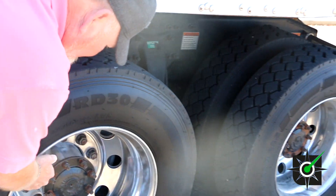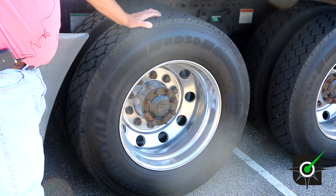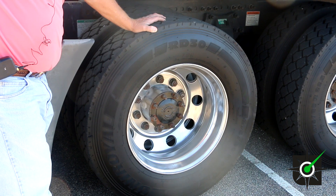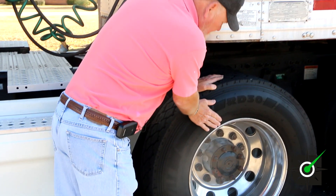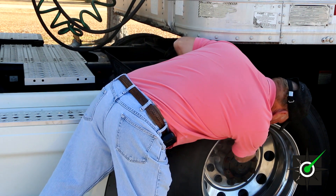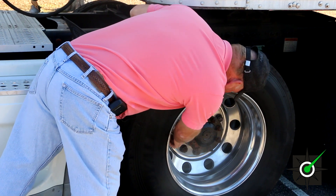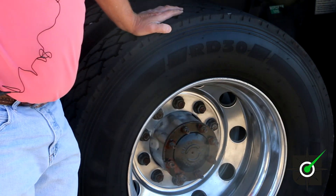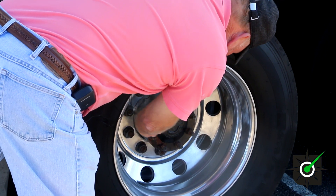Back out to the wheel — the wheel cannot be cracked, and no illegal welds. You can tell them that tire's pumped to 100 pounds of pressure, and you check it with a valve stem. The valve stem is on there, bolted on tight, with a cap, and we check the air pressure with an air gauge. The valve stem here is bolted on tight with a cap. The lugs are bolted on tight — they're not loose. If they were loose, you'd see rust trails on the wheel and shiny threads. This is an axle seal on the tractor — the bolts are there, properly mounted and secure, all tight, and it's not leaking grease.